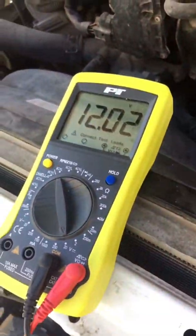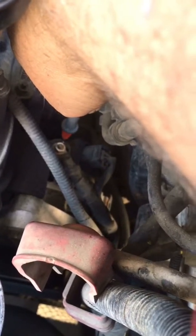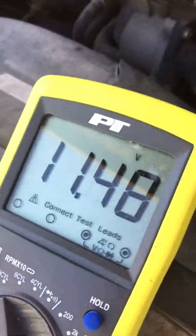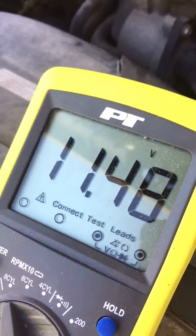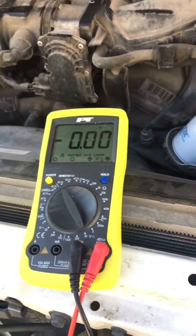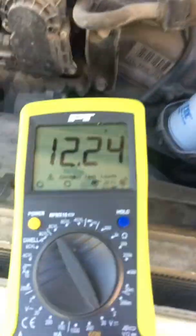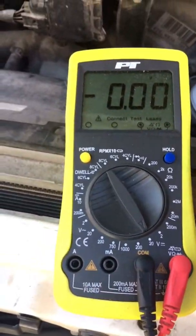So that's down — there needs to be an issue. There's a charge wire terminal right there. We'll put that on there, and that's showing me that the alternator is only producing 11.4 volts. See, now it's down even more. That tells me that the alternator is bad.